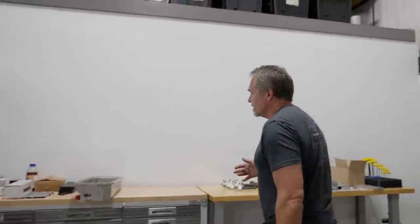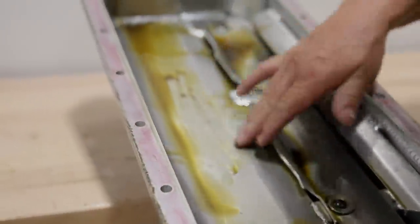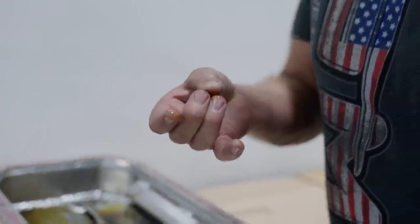So you see, I just take the pan back off. We pulled the pan off at the track and showed you guys it was a thrust bearing issue. So what I'm gonna do is take off each one of these caps and we'll look at the bearing - and you can see that there's no material in the oil pan back here. It's left exactly the same. There is nothing in here - that might be a little piece of silicone, but pretty much nothing in there whatsoever. If there's a bunch of material from bearings or something, you'd think it might be in the oil pan.